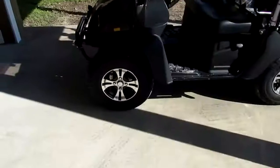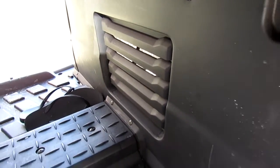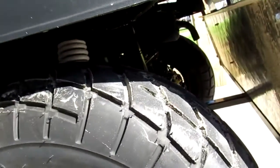The cart does not have a warning light telling you if the machine is actually overheating. It is air-cooled, which completely gets rid of any complications with a water-cooled system. It's not getting enough air — I suspected it was overheating, but it was really my best guess. For this thing to breathe, there are only a couple of places that can do that: there's venting up here underneath the front seat, and the rest is just ancillary airflow in the wheel wells and things like that.